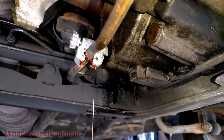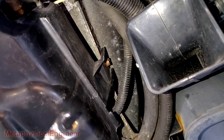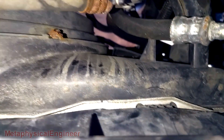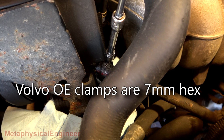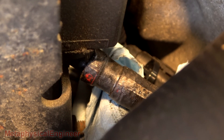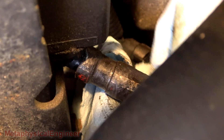You can let that drain and take it down without making a huge mess. Hose fully disconnected. While that finishes draining, I'll get the front splash guard out of the way — 10mm bolt on either side. Just in front of the subframe there's a set of tabs that engage with the radiator assembly; push those forward and the whole thing will drop down. The hose clamp attaches the return line to the reservoir — this is an original clamp, so it's a 7mm. Now that's overdue — look how badly crushed that hose is, and it was still weeping.